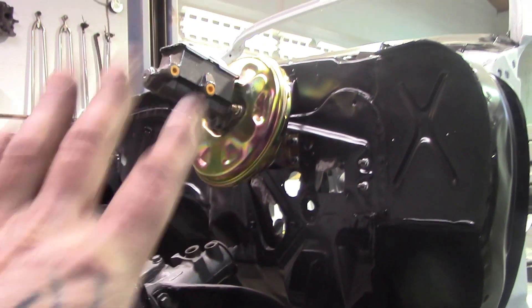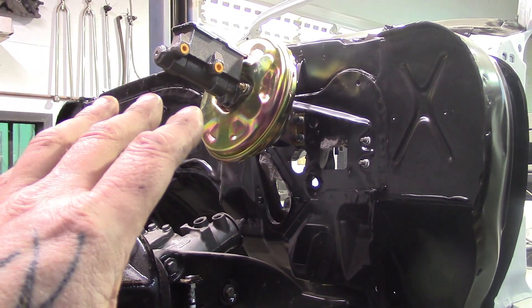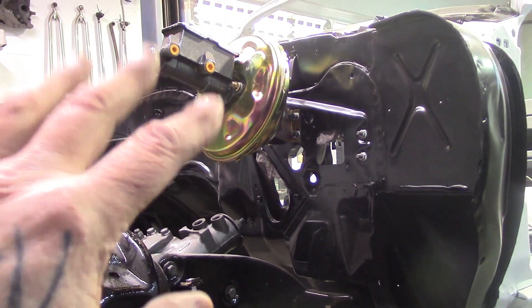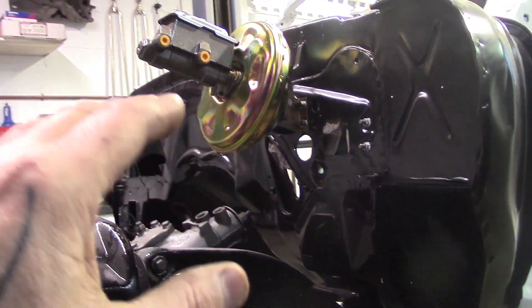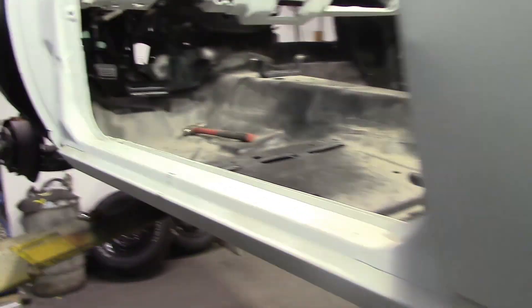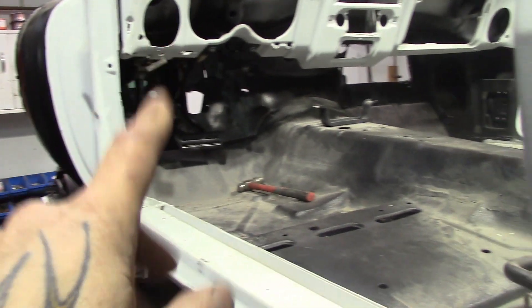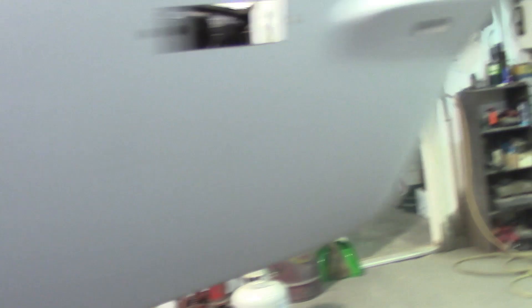Got all that fitted — the power booster is in. Right now just hanging the master cylinder. I don't ever put master cylinders on without bench bleeding them first, it's just easier. Bench bleed them, cap them off, leave them. I'm just hanging it right now so I can figure out what lines go where. Got the firewall pad up and in there, brake pedal assembly in, and the gas tank is getting cleaned up and painted.